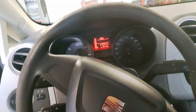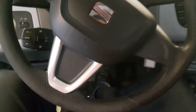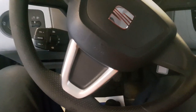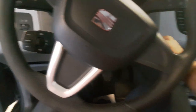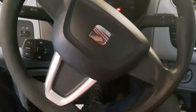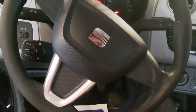The vehicle is back on the ground. Before you start driving, first press the brake pedal a couple of times so the brake caliper can adjust to the new brakes — it's possible the brake pedal will go all the way down a couple of times at first. Now the brakes are good and the vehicle is safe for driving.